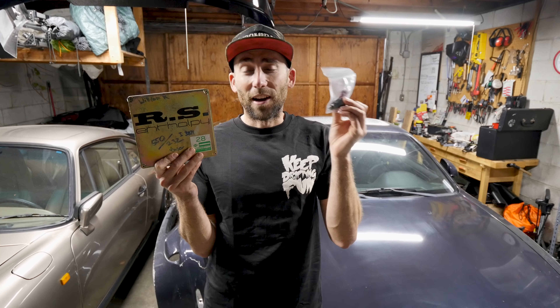So I have three things I'm going to install: the new ROM-tune ECU, the fuel injectors, and the Z32 mass airflow sensor, and then we'll try to start the car again. This will let us know that everything I've installed is working, and then we can add the turbocharger in. This will make things a little bit simpler and have less troubleshooting if there is an issue.